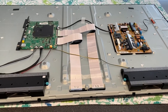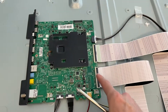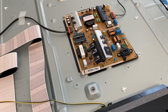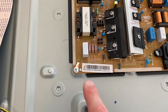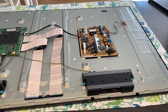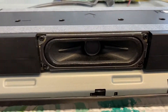At this point I spent about 15 to 20 minutes just taking a look at every single connection point, cleaning it, looking at all the wires, the entire control boards, the connection leads on the ribbon wiring, and every single connection point. I also looked inside the holes and verified no lint or dust that could be interfering with the screen. After that, spent a couple minutes and verified every single screw was properly secured — do your best not to over-tighten those. Before we put the panel on, check out your speakers — pretty neat.